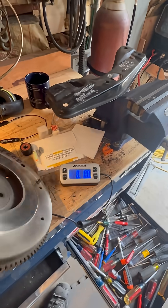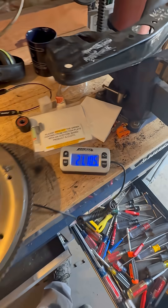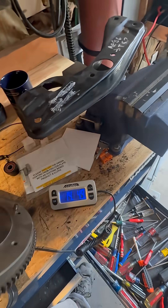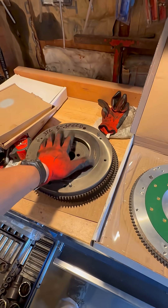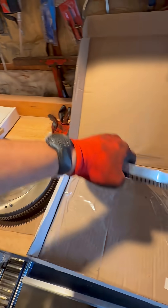Here's the lighter one with less material in the back from the factory. That one is 2 pounds 4 ounces lighter at 21 pounds 10 ounces. So we can see that if you're comparing stock flywheels, this one's just a little bit more desirable, but there probably won't be a seat-of-the-pants noticeable difference.